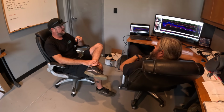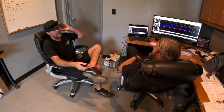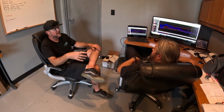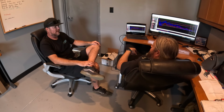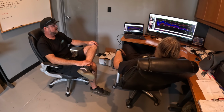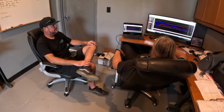If you look at the pass that we made at Drag Week last year, our one and only one, it's just huffing black smoke going down the track, even though it was running out of fuel pressure. Well, it's huffing a little bit on the dyno. It's not terrible, but. Would you go 6.8, 7? Where would you send it? I would start off, I'd just make one at 6.8 and just see what it does.